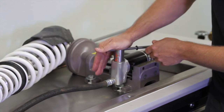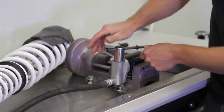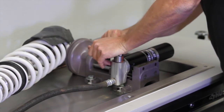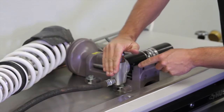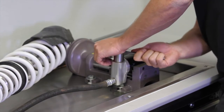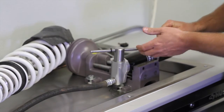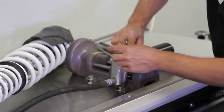As you push this in, just push it in slowly and just twist it till you can feel the tool engage the spots in the side of the piston. Like I said, right now I'm pushing it through and oil slowly bleeding it out. So you have to just be patient with it. Now that I'm connected, I'm going to pull this out, and this one really wasn't too tight. Sometimes these will require a bit of force. Legend has it they have a giant that puts them in on a night shift named Bob.